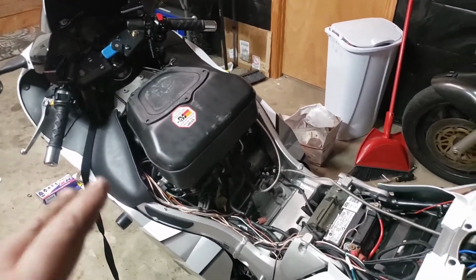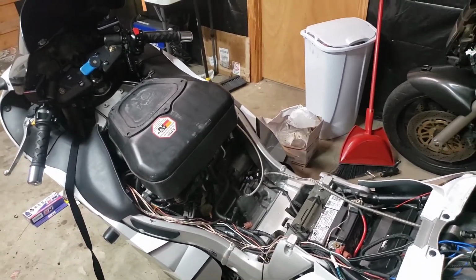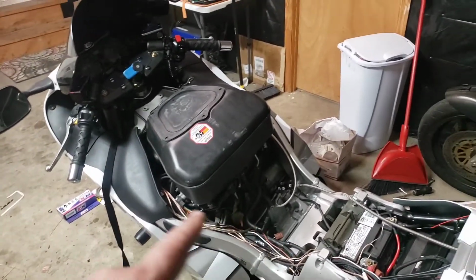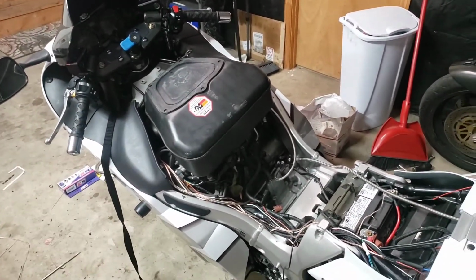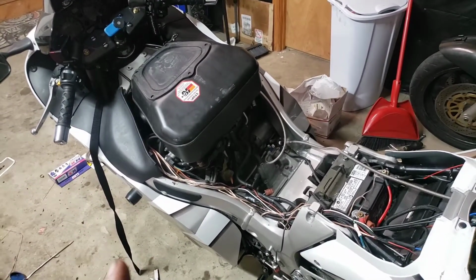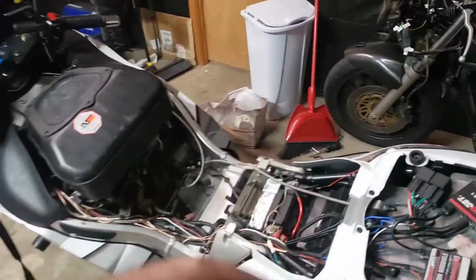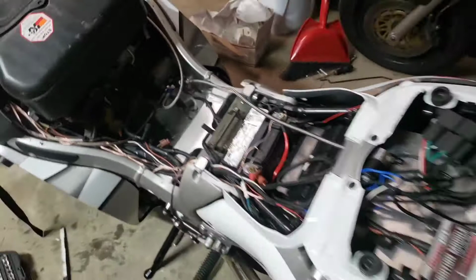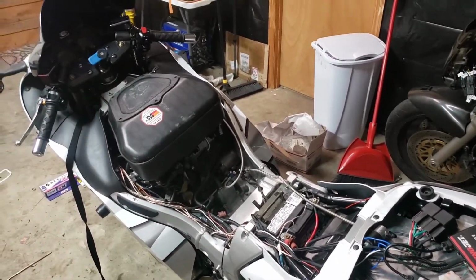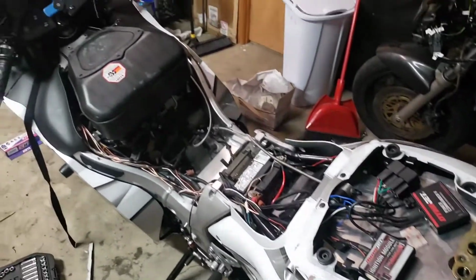Now Junior will be doing all of the install. I want to walk him through it and explain how it goes. First, I want to clean up the spaghetti I have going here. I want to get all my power commander wiring nice and neat. I want to get all this spaghetti crap that I got for the underglow as neat as possible. It's probably going to stay spaghetti crap, to be honest. But I'd like to get a fuse in it because I'm not fused. And get rid of some of this BS on the battery. So that's the next thing I'm going to do here. We're going to strip it down, get it down to where we need it to be for Junior to do his install, because I don't want him to have to deal with the mess I made.